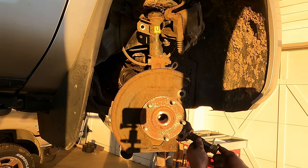And the other huge benefit to this is your engine now gets to run at the optimal RPM. The engine doesn't have to go up and down in RPMs to change your speed. This can go up and down in RPMs while your engine's putting out peak power output based on the engine performance curve. So it makes the vehicle more fuel efficient, and there's no switching of gears or anything like that while you're driving it. Pretty cool stuff.